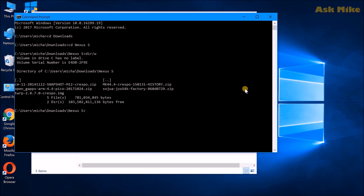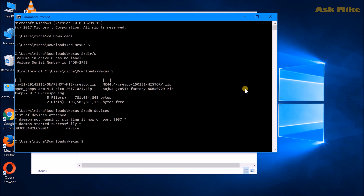Before we start, the first thing you need on your computer is ADB. Make sure you have ADB installed. My recommendation is to install minimal ADB and fastboot — I'll leave a link below to download and install it; it's one of the easiest ways. Next, plug in your phone after enabling USB debugging. You should see the phone show that ADB debugging is connected. Run 'adb devices' to confirm — if a device appears, you're good.